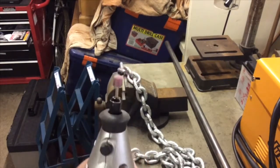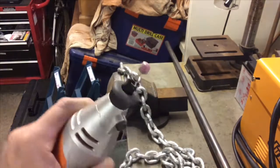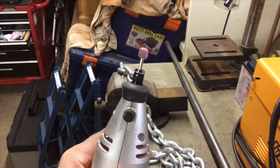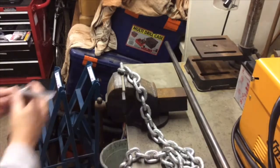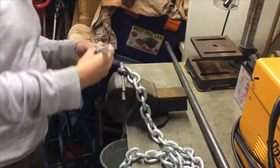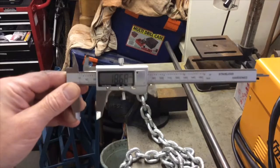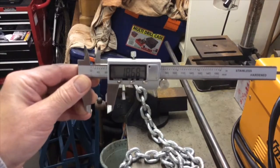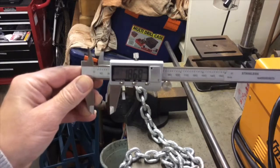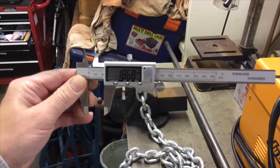Oh, that started off round. Look at the shape of it now. It doesn't matter, but it's going to be worn down soon. It's the only one I've got. Well, with that sort of size shank on anyway, so... There you go. That's the actual original hole's 14.5, so I've actually enlarged it 4mm, and I need to go about another 4mm, so I'm halfway.